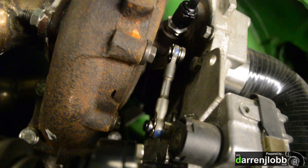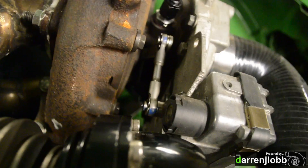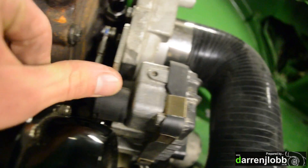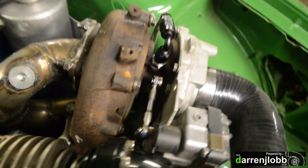You can also see I've just got the actuator mounted on the VNT now. That's a factory electric-style turbo actuator that's actually bolted on as it would have been originally, using the original bolt holes. It's worked out quite well in the orientation on the cold side — I haven't actually had to move it. The only thing I've had to do is just cut some of the housing off because it would interfere with the external wastegate over here. Aside from that, it bolts right on.